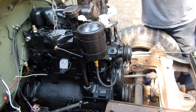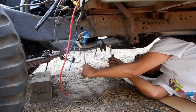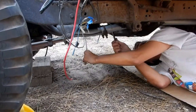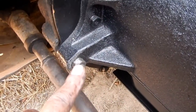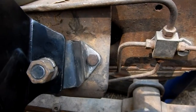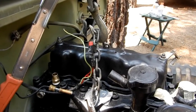All we have to do now is a little more finagling — get a little more weight off of the come-along, get it down onto the motor mounts, and then we'll tighten up the bell housing bolts. Look at Julie go — she's putting the engine back in the Jeep, tightening the bell housing to the block bolts. Don't get them too tight until we get the other ones going. We have all our bolts back in our bell housing, all snugged up, and one bolt on each side of the motor mount.